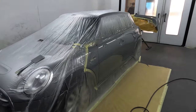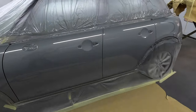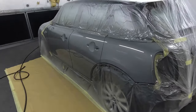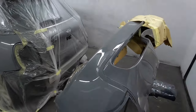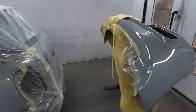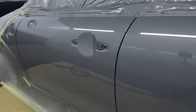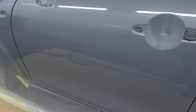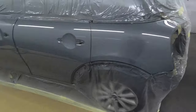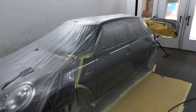The Mini is now all painted and lacquered and ready to be de-masked. Here's a view of it before we de-mask — it's still in the booth and still needs to be machine polished, flattened and polished in any little areas, and of course everything fitted back up. There's the bumper corner as well, which had the small repair at the bottom. We've coloured and lacquered the whole top section too, just so it all blends in colour-wise. We had the damage down the bottom, a few dents up the top, and the crease at the top of the rear quarter panel.